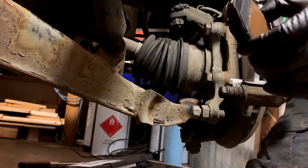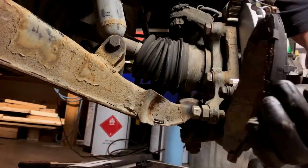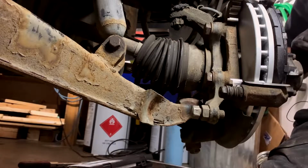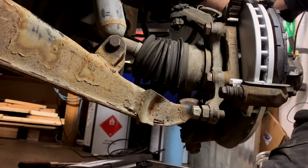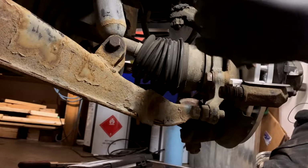And then squealer. Oh, I put it on the wrong side. The squealer faces down, but I screwed it up, so it's gonna be facing up. The way you know which direction the squealer goes is the way the rotor rotates. So this one's rotating forward and the bracket's on the back, so it should be like that. It's on the other side by accident, but that doesn't matter. I can just flip them around next time I'm in here. But in this case, I'm just gonna put it here.